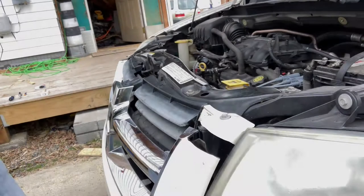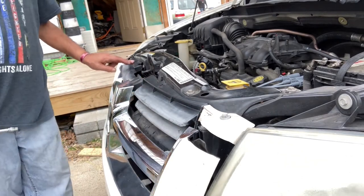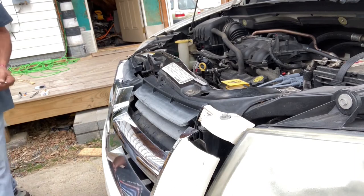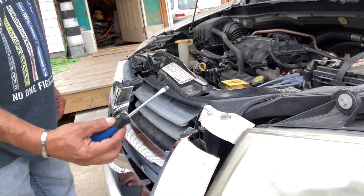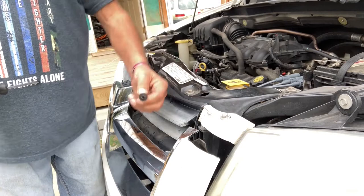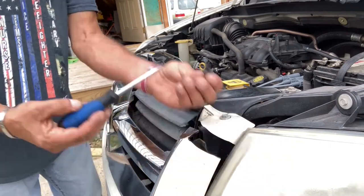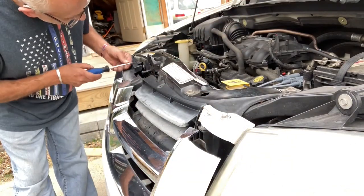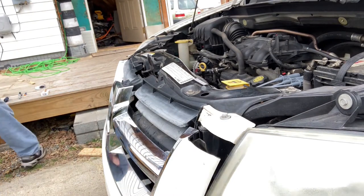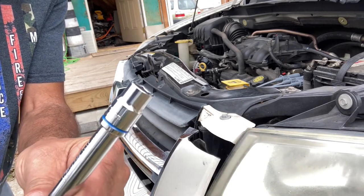The top of the grille has two 10 millimeter bolts and two plastic tree clips. As you'll see here, there are two little indents on the top of that plastic clip — just set your screwdriver in that little groove and twist, the centerpiece will come up and pop right out. Now those two plastic tabs — you have to be really careful because the heat of the engine will dry that plastic out, and when you go to pull it straight up, one or two of those clips will break off. That's a common problem, so just take your time.